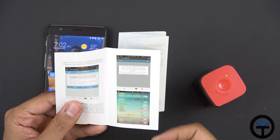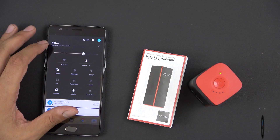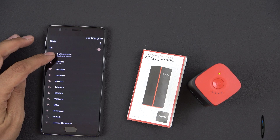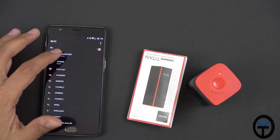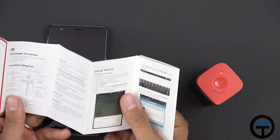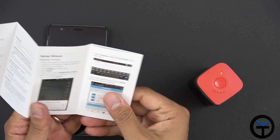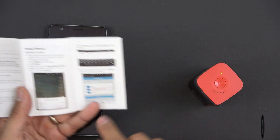There are just a few things you need to know. There is an IP address you need to connect to. First, turn on Wi-Fi on your phone — I'm using the OnePlus 3. In Wi-Fi settings, you'll see a network called "TripMate" — specifically "TripMate-858EO" — connect to it. The setup wizard has you log in; the password is eight ones. Once connected, the IP address you need to log into is 10.10.10.254.